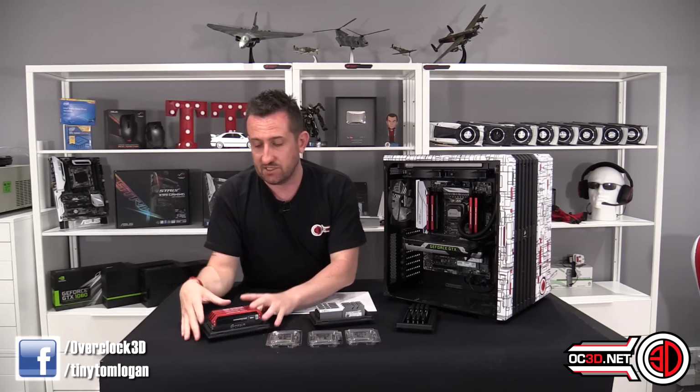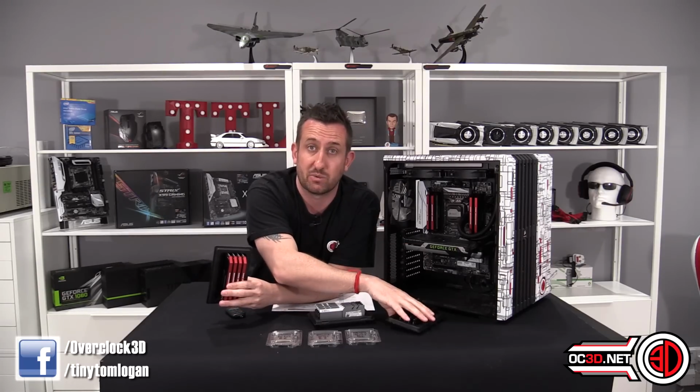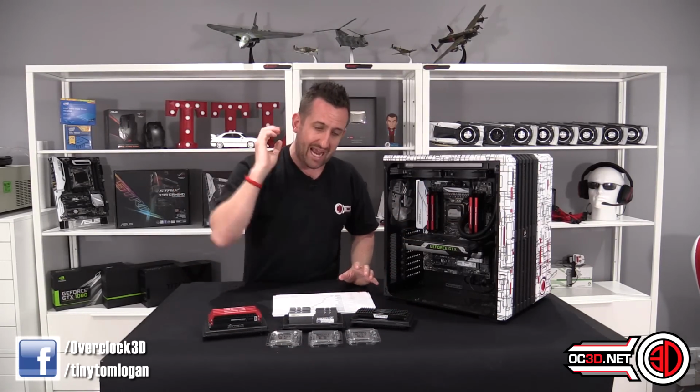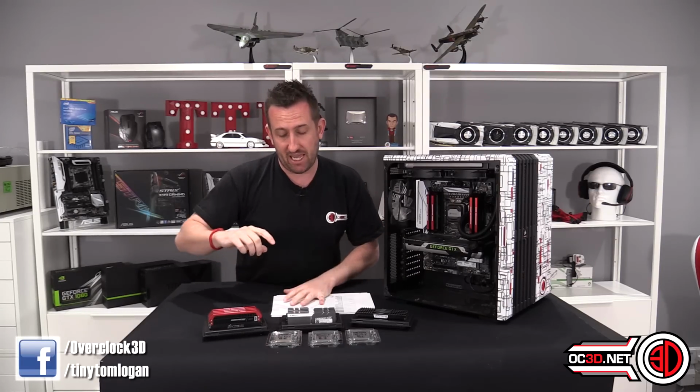So what I ended up doing, especially where I couldn't get the 3600 to run for love nor money, and I even went down to 2800 megahertz, which we know the CPU is able to do, and I just couldn't get them to boot. The board wasn't having any of it. So I've got this 3200 megahertz kit, and when we dropped that in, it was scoring significantly more than the G.Skill was. Now that isn't a G.Skill problem, it's a QVL problem. But it was working better, so that was the kit I went with for my 3200 megahertz runs. I literally just went into the BIOS, selected XMP, F10 out, and it booted. Every single one of the processors booted.